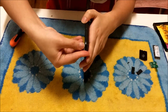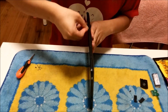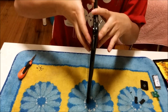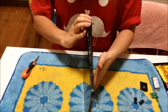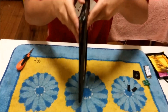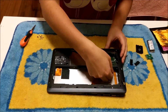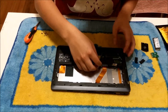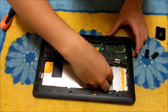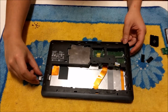So you're going to have to pry the corner where the glass meets the plastic. You can use your prying tool — I just use my fingers. Just go around the edge and it will start popping. I'm just removing the cable that's attached to the motherboard. It's somewhat easier to remove it when you remove the back cover, as it gives you room to put your fingers in. And there's the SD card slot that I forgot to remove.